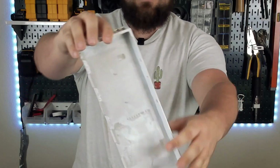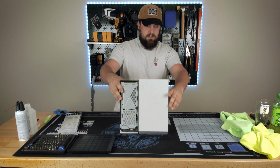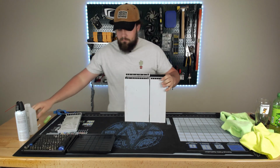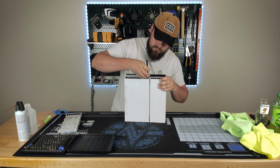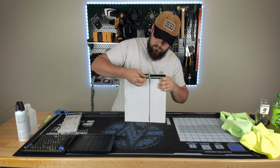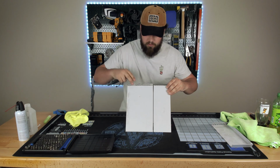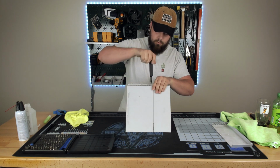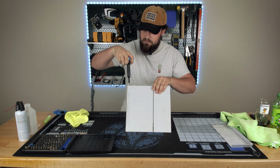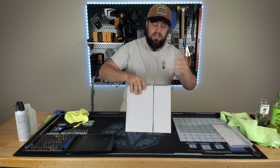Ooh, some nice dirt right there. And this PS4 is the original PS4 that released with the Destiny package. And yes, doing this does void your warranty, but obviously if you're like this PS4 owner, you've had it quite a while and it's not gonna be under warranty. And taking apart a PS4 is actually pretty easy. You do have the Torx security screws holding just about everything in. The only thing that's pretty easily accessible by anybody is if you want to upgrade the hard drives to different sizes or possibly an SSD.